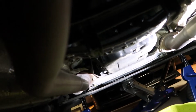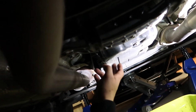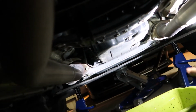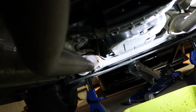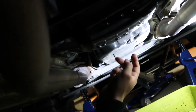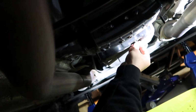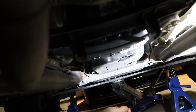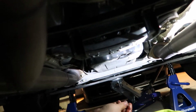So I'm actually waiting on Amazon because Rock Auto, it's gonna take too long to get the filter and the pan gasket, so I might shoot this video in the daylight to make it easier. And then 2 to 3 quarts will probably come out of here. So you just want to measure it when you're done in a beaker, and then just put exactly the same amount back. Damn, that's dark. And then I wanted to mention that you need to have the car level, obviously, to get the right amount of fluid out.